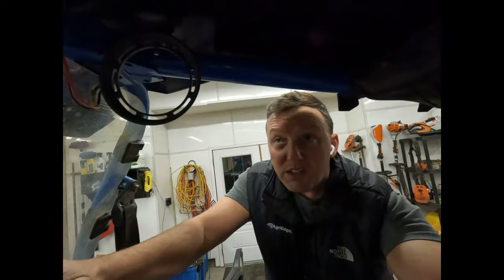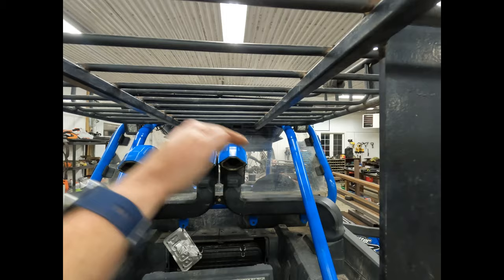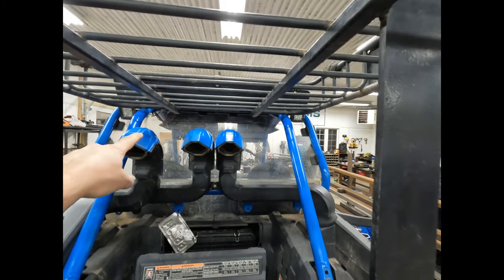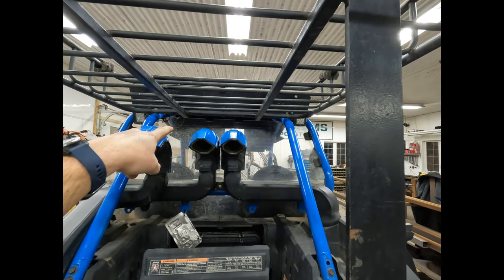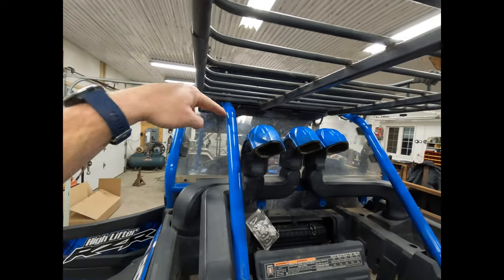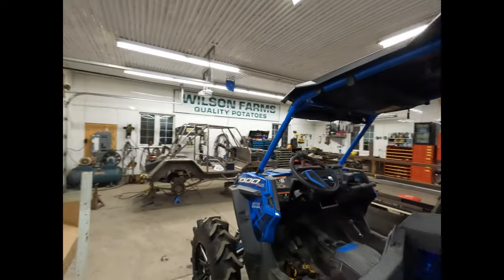Two reasons: one, it just keeps away from the roof a little more and gives more room. Secondly, when the light bar is up there, if you bring it down that inch, you can actually see the light bar. If I didn't bring it down, the safari rack would be in the way. So if you bring it down the inch, you'd be able to see the light bar at the back. That's why I brought it down. You lose a little bit of headroom, but it'll look better.